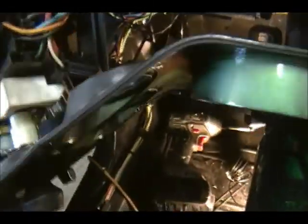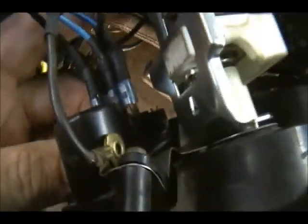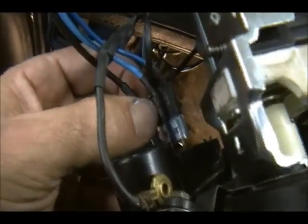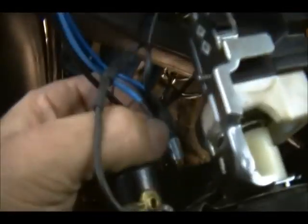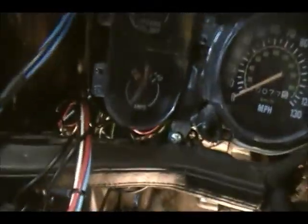And yeah, all the wiring is correct. You have this is a ground, this is low, this is pump, and this is high. So all that seems to be working. And what we're gonna do is we're gonna bench test it to see if it can come out of park. And maybe I have to ground it a little better to the firewall. I don't know if the grounding strap, because I painted it, maybe I'm not getting a good contact on the grounding strap. So we'll just take it off the firewall, unhook the linkage, pull it off, and we'll bench test it, see if it works.